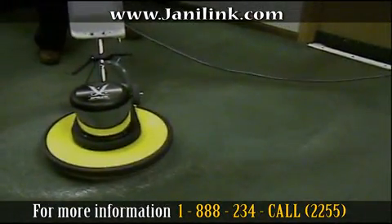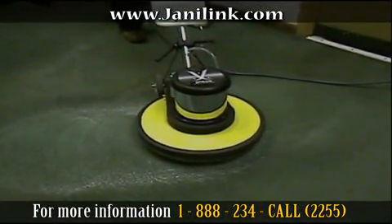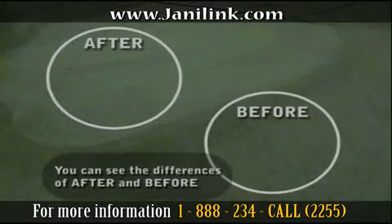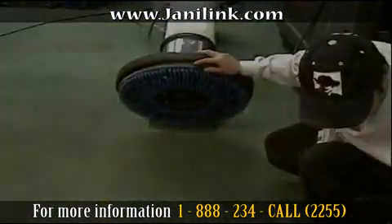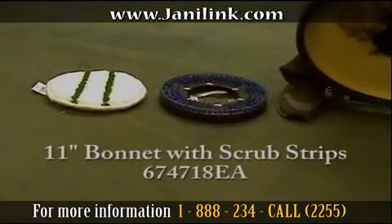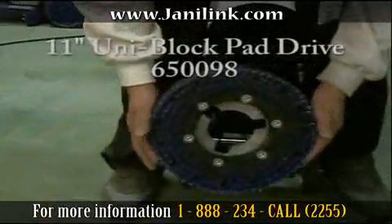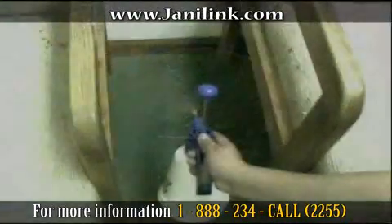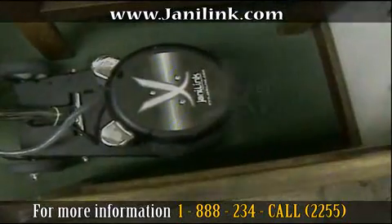You can upgrade your Janilink floor machine with a shampoo tank, which allows you to release solution or water directly from your machine. Look at the drastic results. Next, we will show you that this machine is versatile for small areas on the carpet. Remove the pad driver and unscrew the four pins on the bottom of the machine — the whole plate can be removed, allowing it to maneuver in tight areas like in between chairs. As you put the 11-inch pad driver on the machine with a bonnet pad, you can scrub in between and underneath the chairs, as well as hard-to-reach places after pre-spraying.